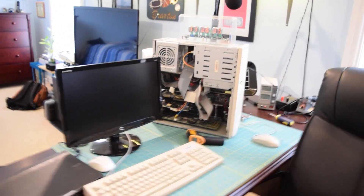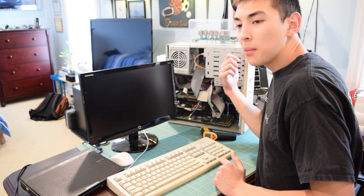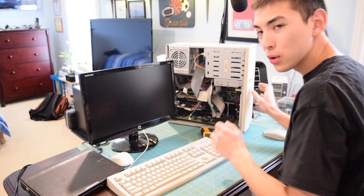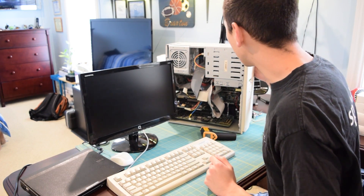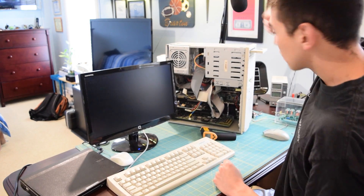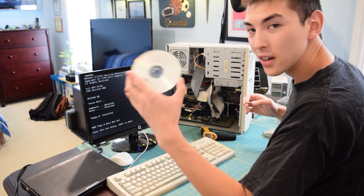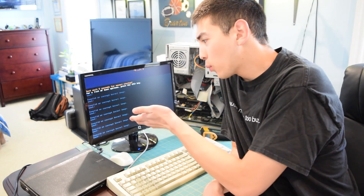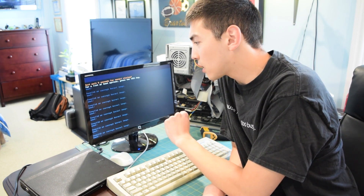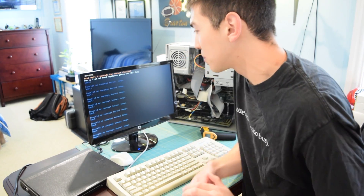Let's go ahead and turn the system on and see how far it gets before it freezes. I don't think the CD-ROM drive is working in this system — I tried to boot off the CD-ROM drive using Plop and had no luck. It's one of those CD-ROM drives with a built-in eject workaround, or I guess you could call it the anger management function — give it a little tap and it'll come right out. I did try to boot Puppy off a CD-ROM. I'll get weird errors like this sometimes when I boot up through the flash drive — if I reboot the error will probably disappear.